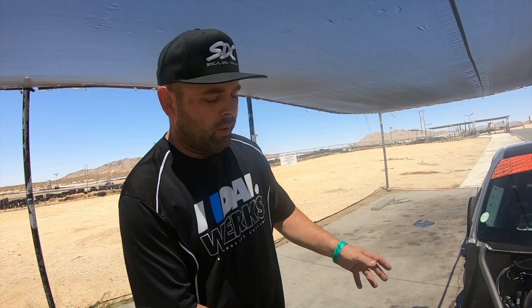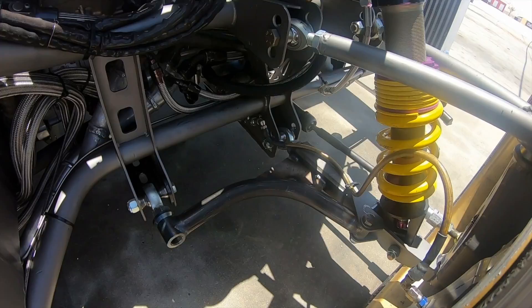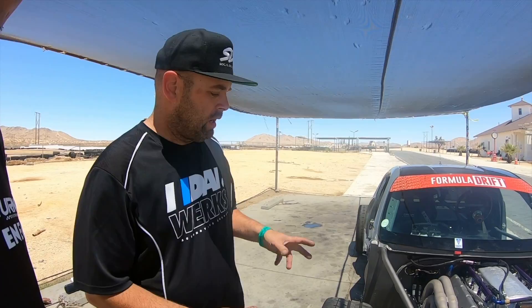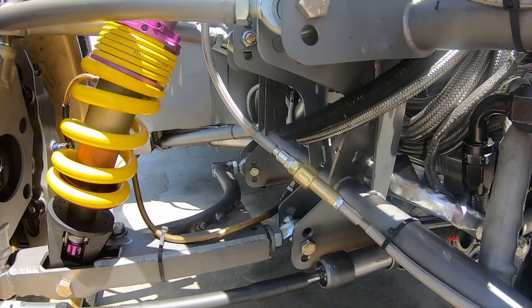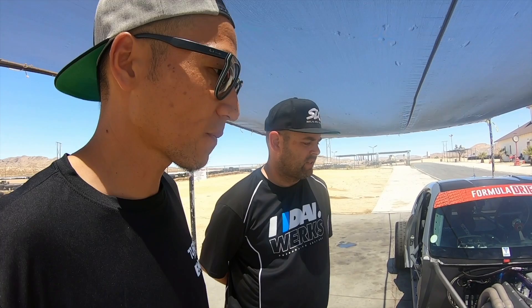Now, because it's not a competition car anymore, there are no rules — why not go wild and really get a good understanding of what makes a drift car work? So what did you do? Double A-arm — upper and lower A-arm — so there's no more strut. The shock is actually a shock, not a strut, which offers adjustability top and bottom and forward-back so we can control all aspects of suspension geometry. There are additional holes to mess with the roll center and anti-dive — another thing to play around with to learn more about what makes these cars work. Driving wise, right out of the box it should be a very drivable car.